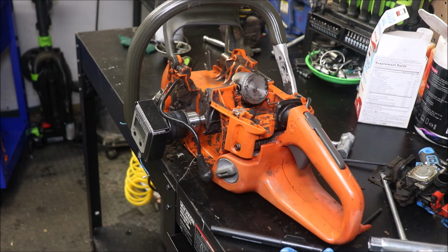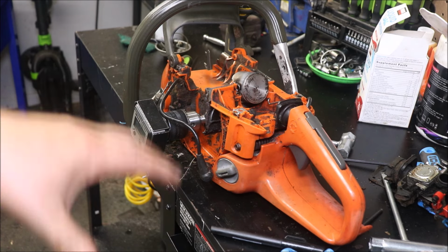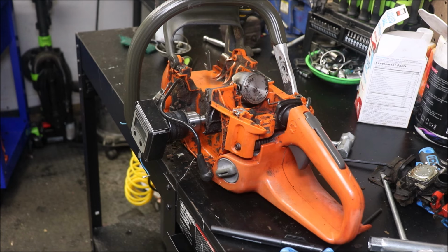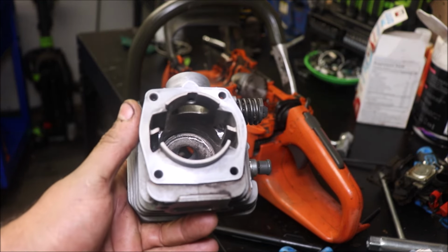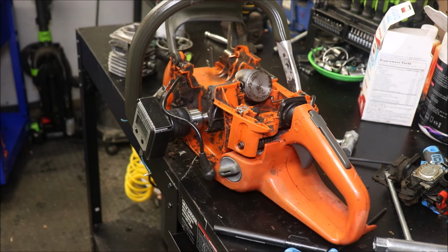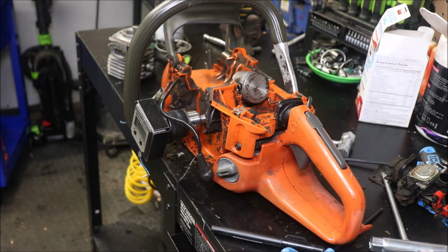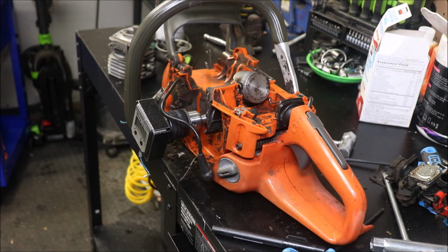That's not possible technically. You're aiming it down into the bottom of the saw where you want the charge to go when it comes through the intake. As the piston comes down, it compresses the charge in the crankcase and up through the transfers. You're not aiming the charge into your transfers. If you think that's how it's doing it, you don't understand how these work yet. If you're going in and widening and doing a little bit of case match up, a little bit of unshrouding, that'll do just fine. But if you're hogging the piss out of things, you still don't technically understand how this thing works. I don't mean to sound like a know-it-all or a smart-ass, but I guess I kind of am being one. You want the fuel charge in the bottom when it compresses as the piston comes down, and it shoots up your transfers toward the back of the combustion chamber. It loops around and out the exhaust port.